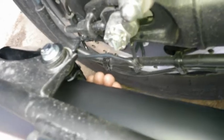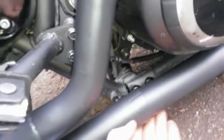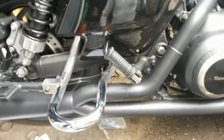So down here in the main body of the exhaust, there is a bracket. You slide the small metal nut plate into that hole, thread in those two bolts. Here's that slip joint. I kind of had to fiddle with it to get everything to line up, not beat up on the jug too much, and then the two acorn bolts for the rear exhaust. Next up should be tightening, and then the shields.